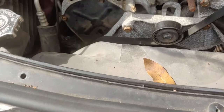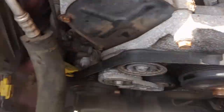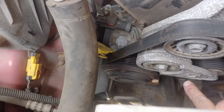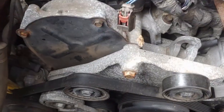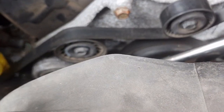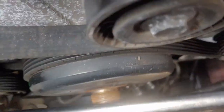Let's see what's next. Looks like the serpentine belt is next. They're all in here different. This one may be manipulated through this hole here, which might be a 3/8 drive socket or ratchet. May do the job. Let's see here. Let's see if it's a 1/2 inch. Looks like it is. Golly, that is stiff. Alright, slide it off this idler here because it's smooth, see?